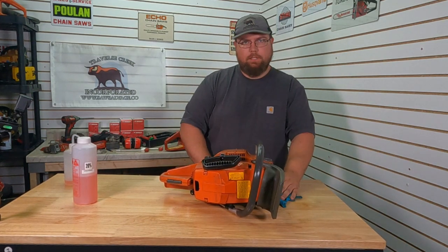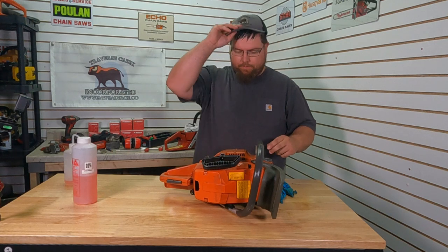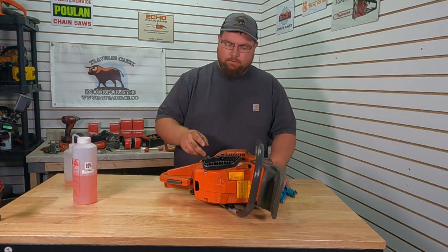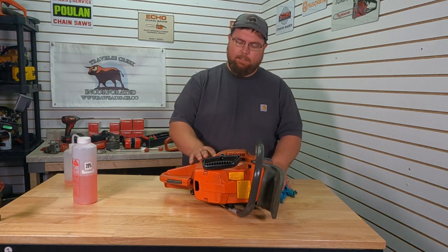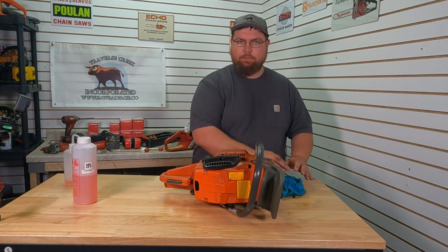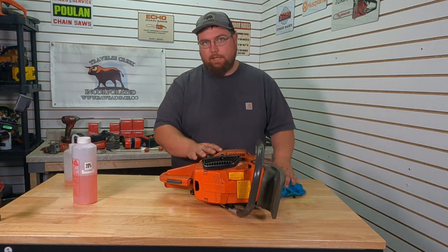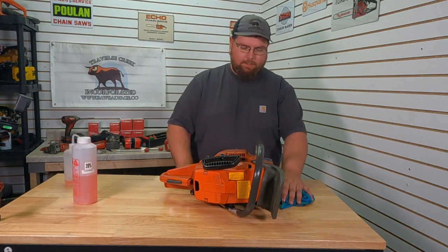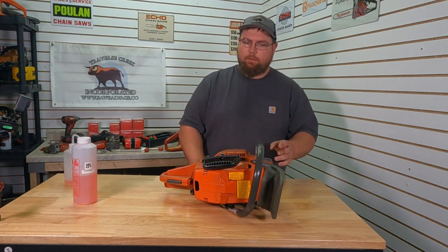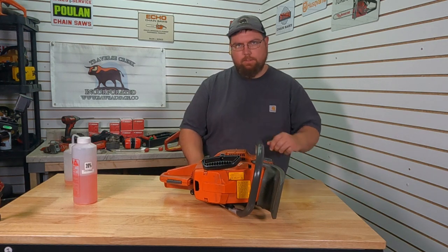That's where a lot of people think that you can swap back and forth. If your carburetor will run alcohol nitro good, it's not gonna run gasoline. So they are indeed two separate things. If you run gasoline real good, you're not gonna flow enough to run like you need on the alcohol nitro. But we made some pretty good power, and I'll drain this and we'll look at the graphs.